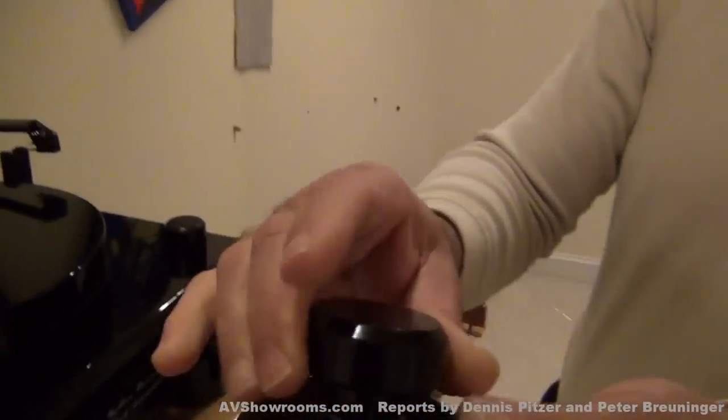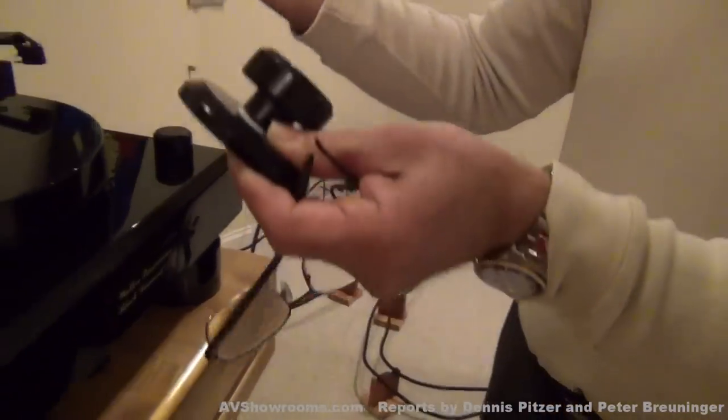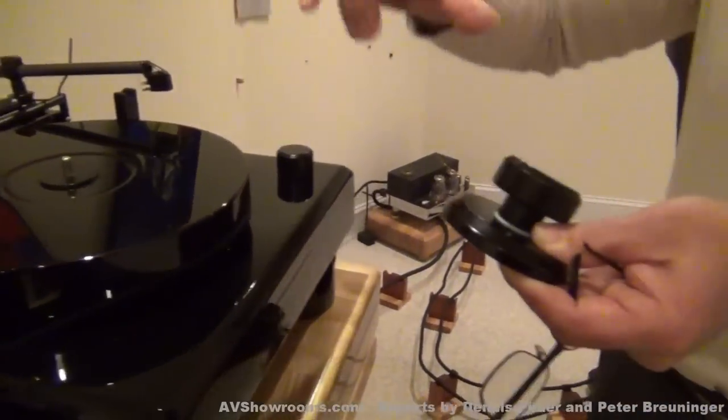Part of the process here, if you'll see, is a very, very heavy brass clamp. It is a locking clamp which Lloyd designed to couple the lead platter to the disc. So when you're putting a record on, you'll want to press firmly the clamp down and tighten it so that there is total connection between the platter and the disc. Many manufacturers will choose to leave a record loose on a platter, and that is absolutely opposite of Lloyd's philosophy. He wants total connection.